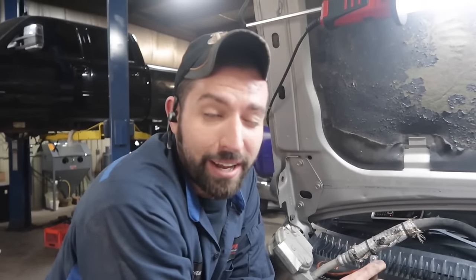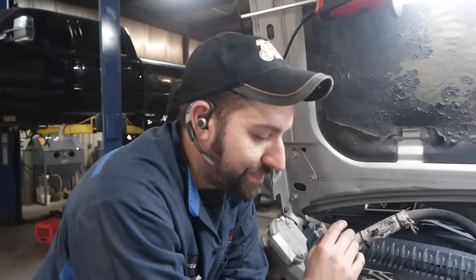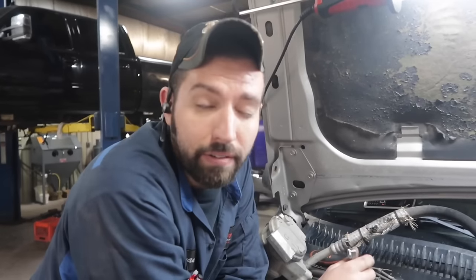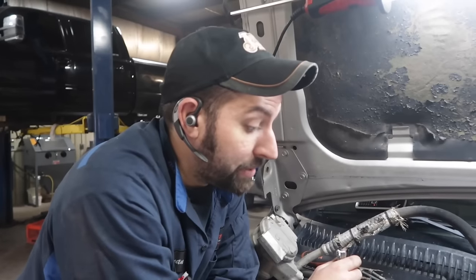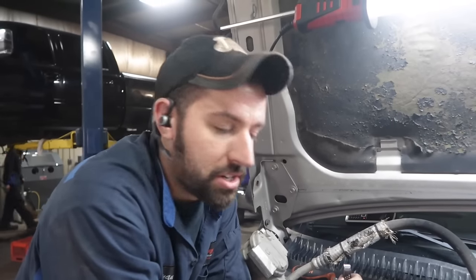You don't know how many times I've heard that come back to bite guys hard before, so I cannot stress enough, if you're lifting that valve train out, take the hour it may take you by yourself to adjust these valves and make sure you have everything correctly adjusted. That can be detrimental to the motor. It will blow up if you don't have them adjusted properly and they're that far out of spec. Especially if you're taking your heads to the machine shop and actually having the heads milled.